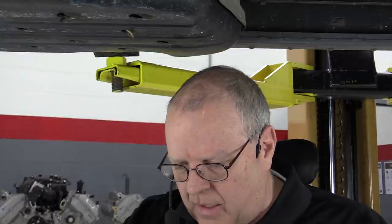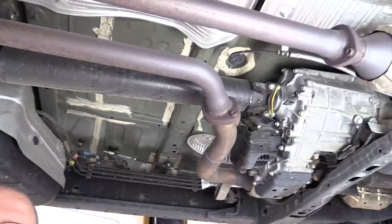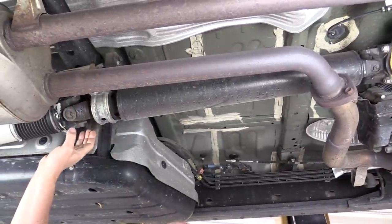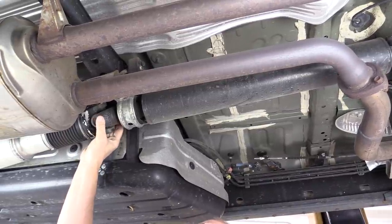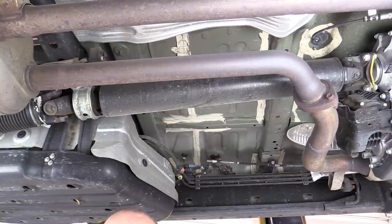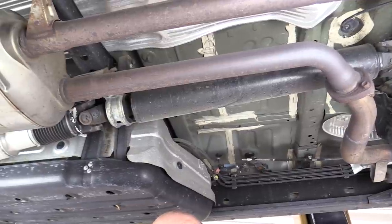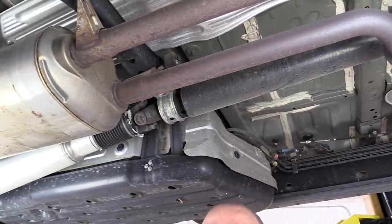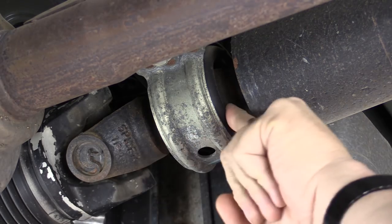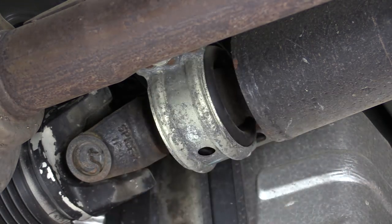Next, look at any slip joints in the drive shafts. This front drive shaft is bolted solidly to the transfer case, coming all the way back to the center support bearing where it has its own bolt-on end yoke — there are no slip joints in this front drive shaft. That's because there's little or no movement that needs to be taken up, and any slight movement is absorbed by the rubber mounting of the center support bearing.